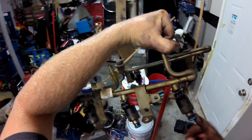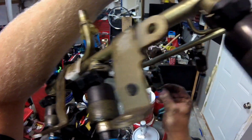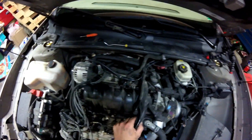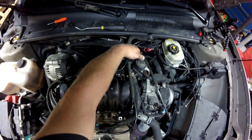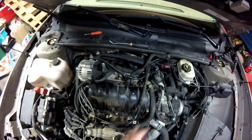I like to make sure that all the O-rings are good. These don't look like they need to be replaced, so we're good. It's looking a little bit easier to get our intake off. We still need to take the EGR valve bracket off because it connects to this intake here.